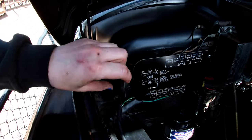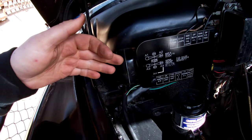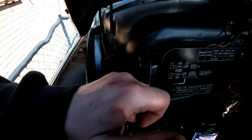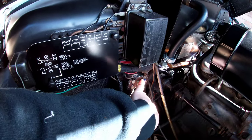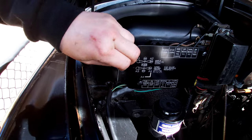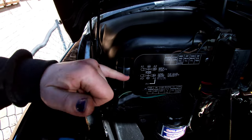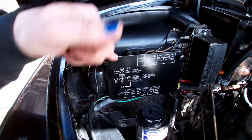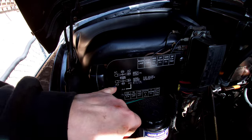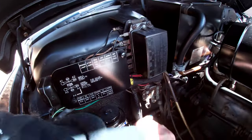This is the overdrive fuse box. Under there there's one glass fuse - 35 amp I think. So if you're not getting power, that's why - fuse blown. It's always worth just popping that cover off with a screwdriver and you can see the glass fuse in there, just check it's okay. The wire from this goes into A3 in this fuse box, so you can see the little green and white wire - or slate, they call it green slate - going into terminal A3 in the fuse box.